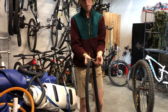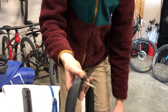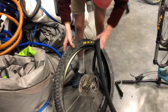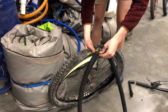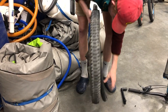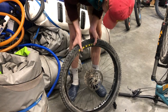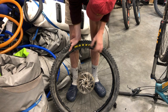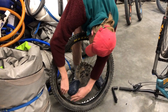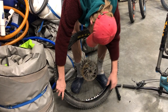Take the lock ring off of the new tube as well, and re-close the lock nut on the Presta valve to make sure it doesn't break the internal valve. Go back around and find the valve hole in the wheel. Pull the tire out of the way, put the valve through the wheel, then pull the tire up and over the tube. Go around and stuff the tube into the tire all the way, then starting at the valve, pull the tire over the wheel and stuff the bead down in there — you'll usually hear a little pop as the bead catches. Make sure the tube is not getting stuck between the wheel and the bead, as that's how you cause a pinch flat — it'll expand and blow the tube, which is very loud.